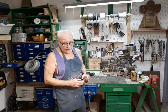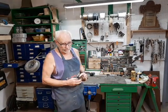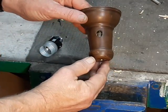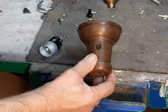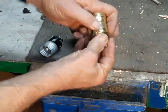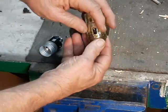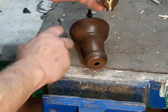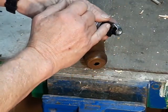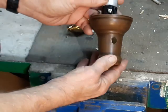Well, this hasn't turned out to be as simple and easy a job as I had hoped for. The lamp is now finished. The customer kind of picked it up before I discovered that quite a few video clips somehow got lost. This included the clip where I explained that someone had rewired this lamp with a regular shell socket. Shell sockets are made to come apart — if you press right here the bottom comes off. That's pretty good because you can wire it up and stick it back down in there and twist it tight. However, it means you can't get this piece back out without damaging it. The correct socket for this kind of application is called a hickey socket, where this bracket on the bottom — the hickey — comes off and you can wire it, then pull it back down and fasten it to the hickey. And we will now resume our regular video.